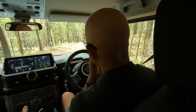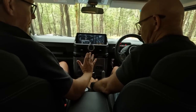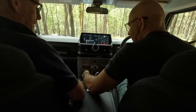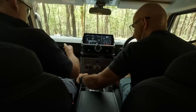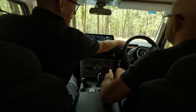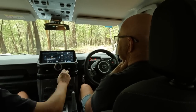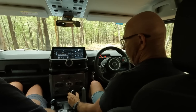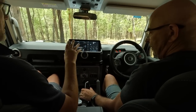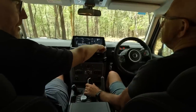To a stop. Put the handbrake on, put it into neutral — just literally push it forward. We're now going to lift up and put it into low range lock. We're now in low range, centre diff locked, and it also says it's in low there. We're now going to select drive, and just remember this has no electronic stability control, no ABS on this vehicle. Put it over into manual. We're now in manual first gear. This will not change gear until you command it.